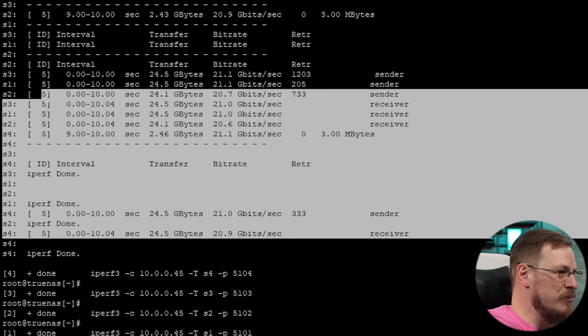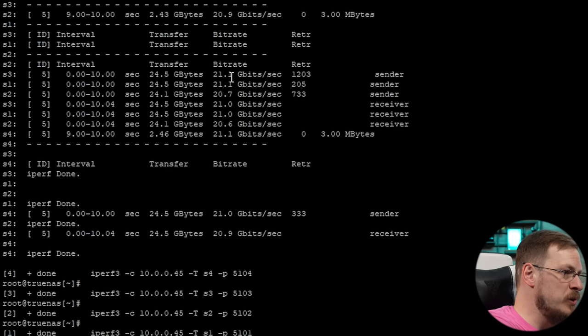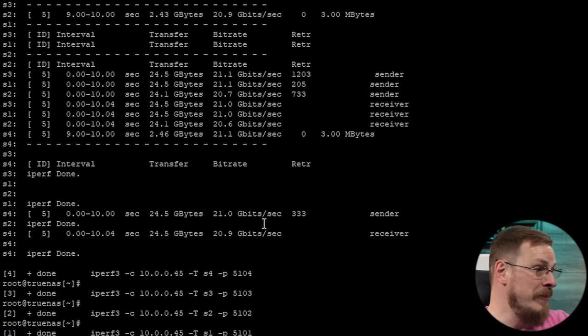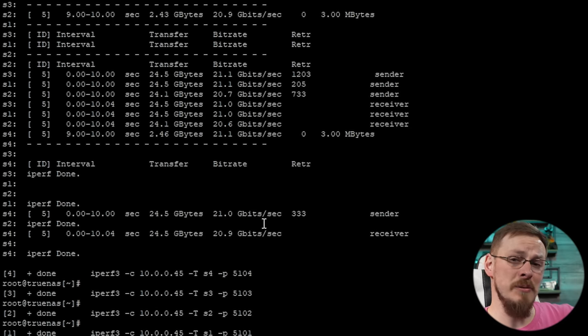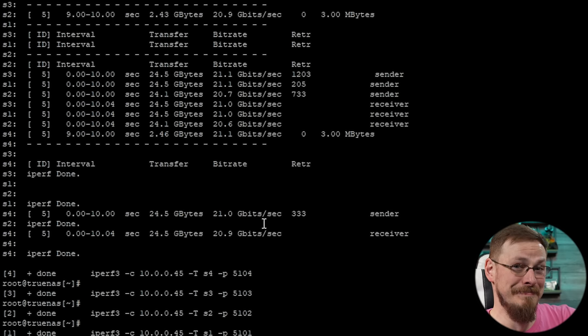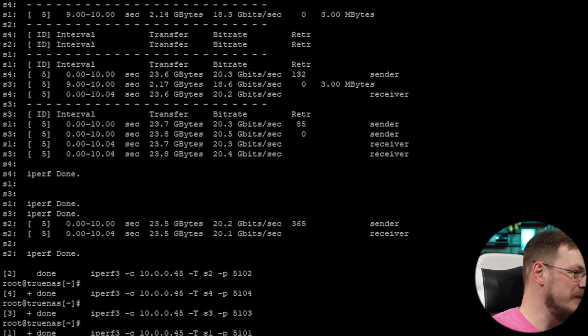That's what we just did. So if we take a look at our results right here, you can see the four uploads, sender, sender, sender, and sender. We're doing 21.1, 21.1, 20.7, and 21.0. Similar on the receive end, 21, 21, 20.6, and 20.9. My math's a little fuzzy lately, but that's what, 82 gigabit per second? I will say off camera, I was able to get all the way up to 91.6 gigabit simultaneous transfer. I'm pretty happy. Let's go and run that again just for fun, because it only takes 10 seconds. There we go. Pretty similar results across the board there.